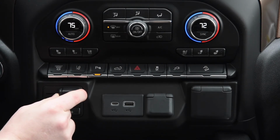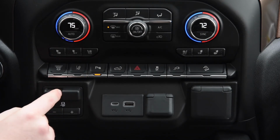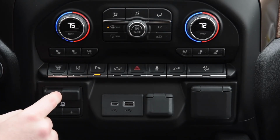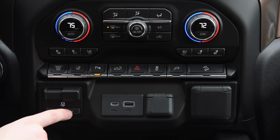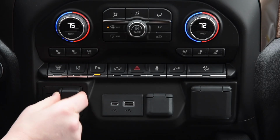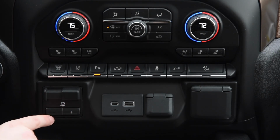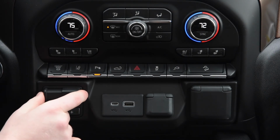Once it stops your trailer, it'll tell you on your speedometer here, it might say 3 gain. That means you need to hit this 6 times because it goes by half a gain each decrease and increase. Once you get it to 3, do the same thing again, 5 to 7 miles per hour, hold it down until you stop, and then it'll tell you to increase or decrease by however much gain, and that's how you get that set.